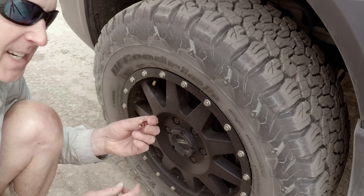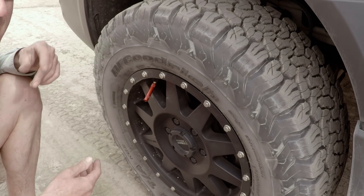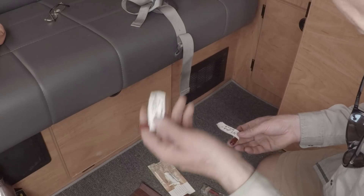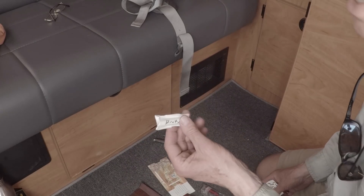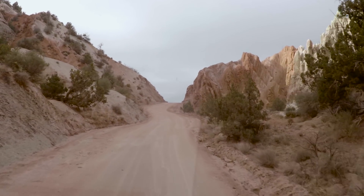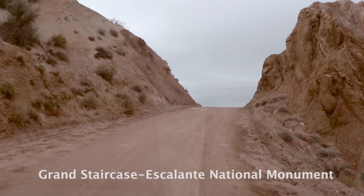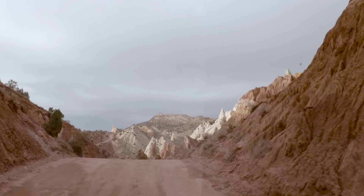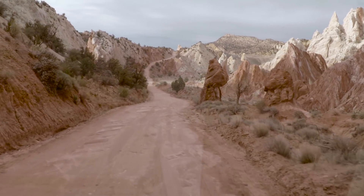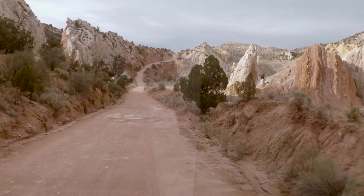After you think you've got it set up to deflate to the right amount, you screw it on and it auto deflates down to whatever you think is right — I'm shooting for about 40 PSI. With the Sprinter, the front and back run at different PSIs, so I taped labels on the front and back deflators. Now we're driving with the tires deflated — I'm going easy, not over 25 mph. Keeping it around 20-25 mph seems really slow, but when the ride's smooth you're not in such a hurry. On washboard it's rattling and shaking, which is not good for the rig or your nerves, so it's really nice to have it soft and smooth.